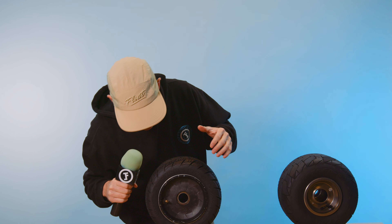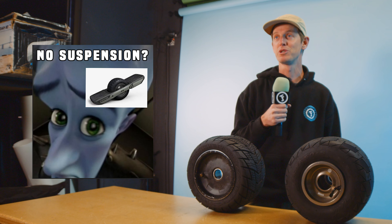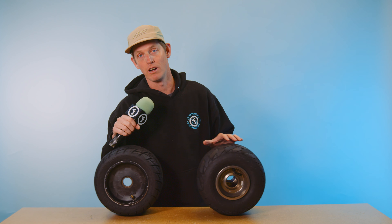We've got right here a stock One Wheel GT hub — this thing is a 6.5-inch diameter rim. Remember back in the early 2000s when everyone was rolling on Escalades and Yukons with 24-inch rims and spinners? Have you ever seen any of those on the Rubicon Trail off-roading? No — those cars would drive like crap, and that's even with suspension. One Wheels don't have suspension. What you do see on the Rubicon Trail is tiny little hubs and big old tires, because all that extra meaty rubber is used for shock absorption and grip, and you can air down your tire a lot more.